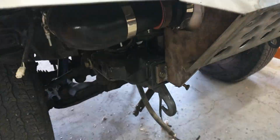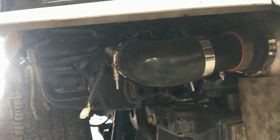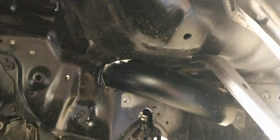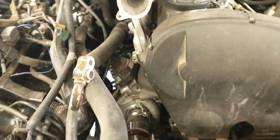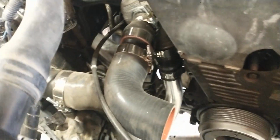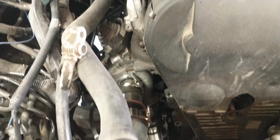And then the intercooler piping is pretty complex to get cut through there. It does have to go into the wheel well a little bit, but the inner fender would cover that. And being this GTC 1549 pointing straight down, he had to turn it down, get in there where you can see, and do a 180 around and up into the turbo.